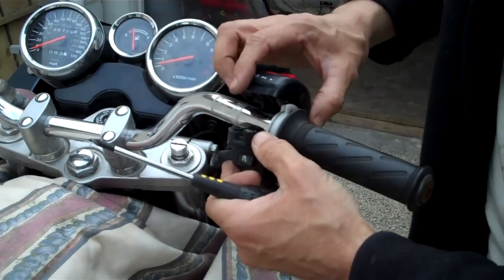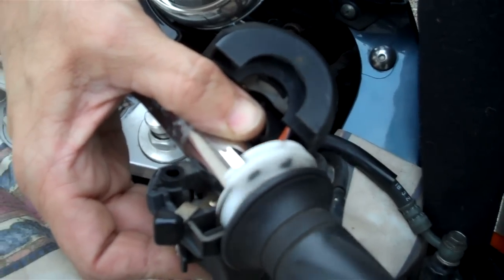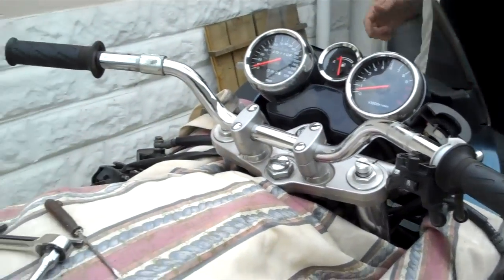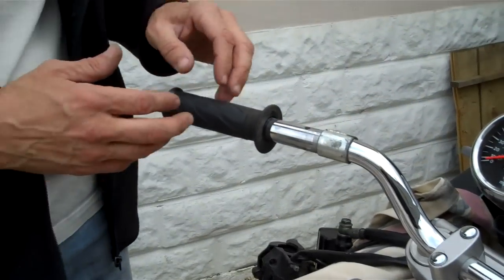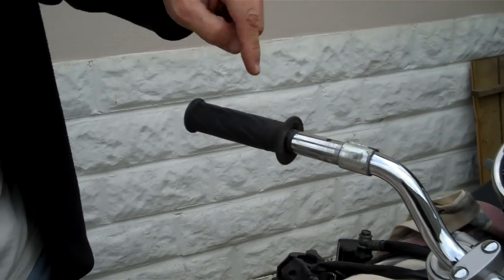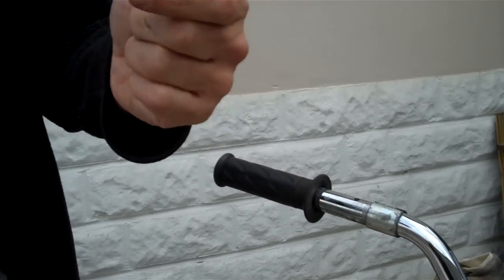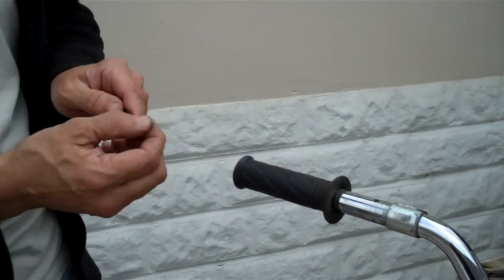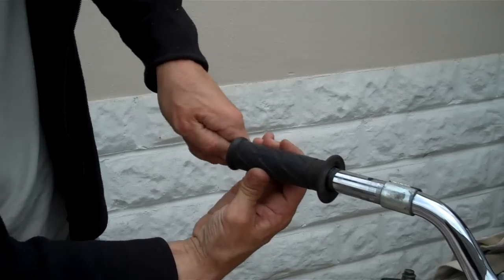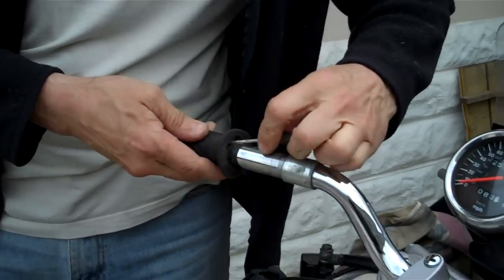This is the throttle side switch block — it comes undone, but looking in here there are the actual throttle cables. I'm going to save a little job and not undo them, there's just no need — I'll show you a trick in a minute. That's going to stay where it is for now. On this side, it's time to get the grip off. I've seen people cut these grips off because they're often glued on at the factory, but there's no need — it's a perfectly good grip. Just use a screwdriver, pop it up inside gently, make sure there's no sharp edges, push it up inside to the hilt and work it around the bar — it just breaks all the glue.